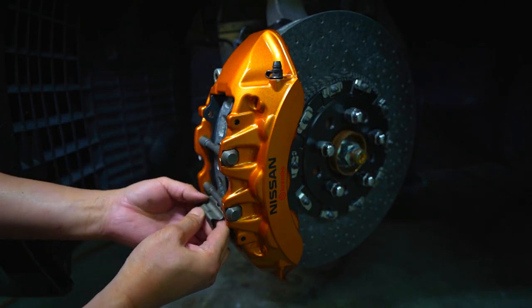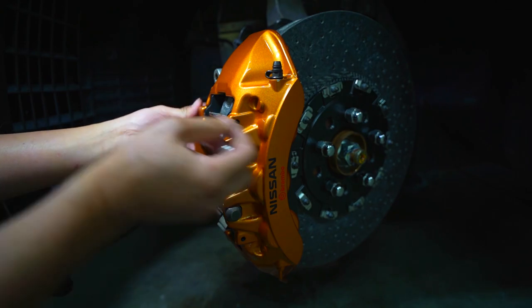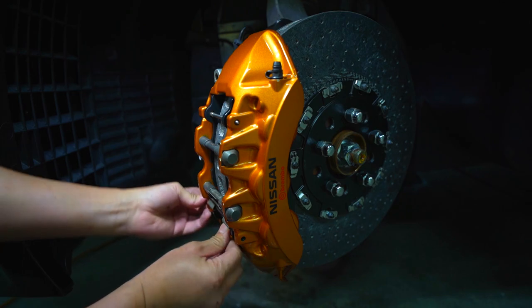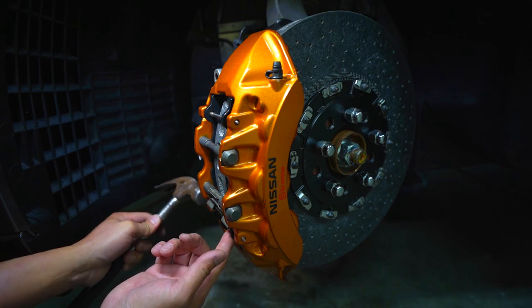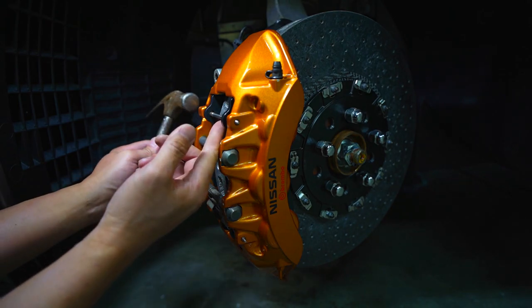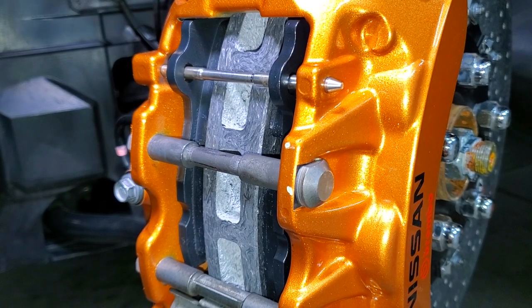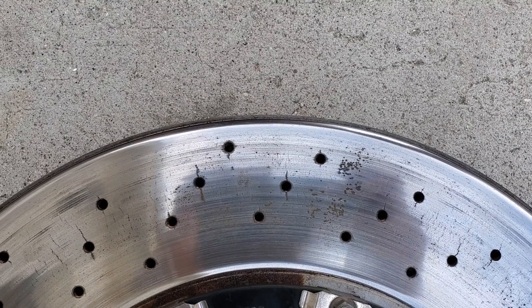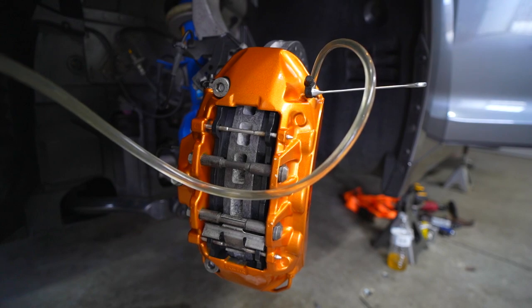Next are the top and bottom caliper bridge bolts, secured by two bolts and torqued down to 22 foot-pounds. The bottom bracket just clips onto the bottom bolt. These two friction pins are the last items to be installed — they enter from the back of the caliper to secure and align the brake pads. Once both friction pins are installed hand tight, I lightly tap with a hammer, avoiding hitting the calipers. The carbon ceramic disc actually sticks out a little above the pads, which is fine — the OEM GTR steel discs also stuck out past the pads. Now it's time to add brake fluid and bleed the brake system.